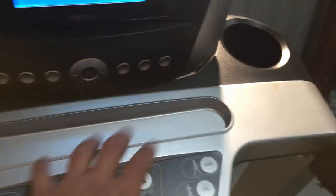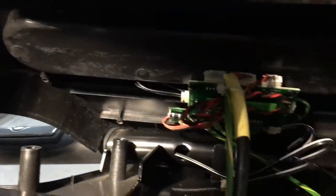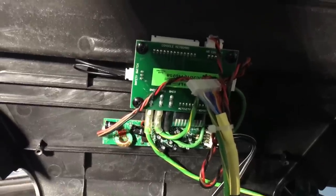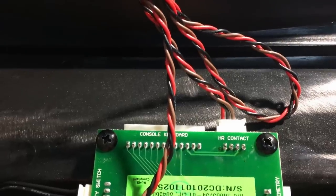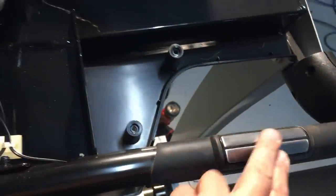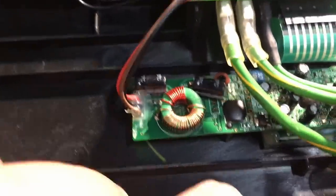I think I might see if I can work out how this panel comes off to have a look in here. I've undone all the screws and under here it looks like we've got another circuit board. I'll see if I can unplug this connector and flip it over for a better view. We have a membrane keyboard that plugs in here, and HR contacts - that could be heart rate. Those two contacts go to the pads here and here, so that must be for heart rate sensing. There's a blob chip in the middle and a few other components.